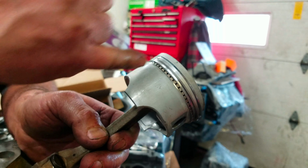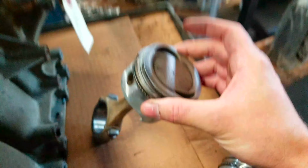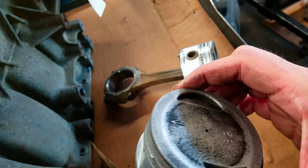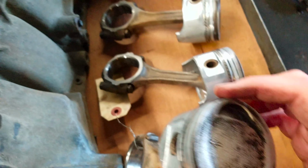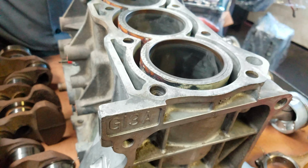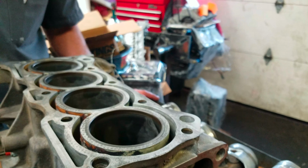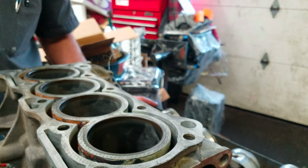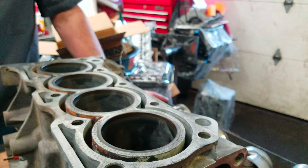Oh yeah. So what we look at is this fine scratching going this direction. Like I said, that's either from dirty air, which is what my first guess would be, or just lack of lubrication. Gotcha. Well, there were two instances where this thing had been run almost completely dry of oil, when we were taking it home on the highway for a while, basically pinning it the whole time. And then some other times where I didn't have oil on me and I had to go get oil. It was burning and leaking it really bad, really quickly.